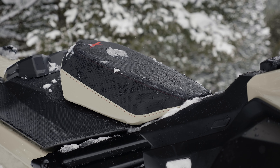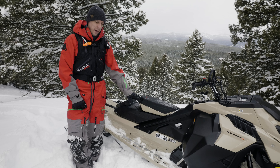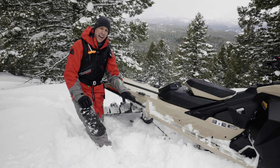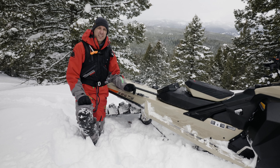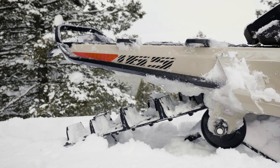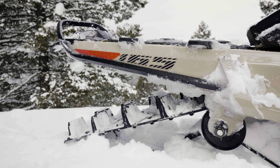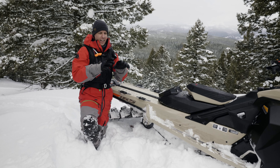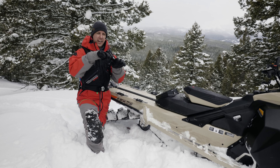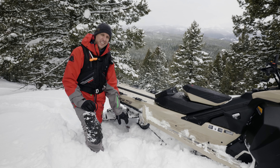The Summit X features this compact seat — as you can see it's quite small and out of the way. It's not quite as small as what's on the Expert Package, but it's really narrow, tapers towards the top and the back. Of course the Summit X has the T-Motion X rear suspension, which has that pivoting arm — it pivots two degrees or so each way to give you a little bit more traction as you're going over undulating or uneven snow. A comparison I heard — I think it was Carl who said it — is that it's kind of like running an enduro tire with low pressure, so that tire can just grip the surface a little bit more and get better flotation, especially with that 16-inch wide track.